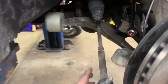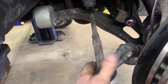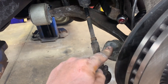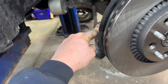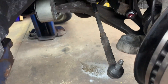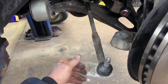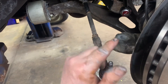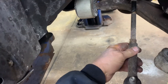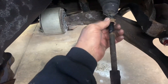I'm going to remove the inner and outer tie rod. You want to undo the outer tie rod nut, which is a 21 millimeter. You might have to heat it up with a propane torch or map gas, then remove the nut. You might have to pry it up into the socket with a pry bar to keep it from turning, but once you get the nut off, smack it with a hammer to break the taper loose. Then get yourself some pliers and remove the clamp.